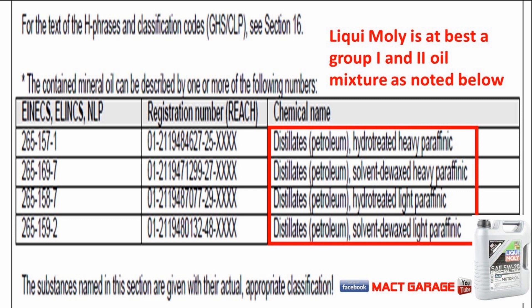This is really getting complicated here, but I'm going to tell you right now — we probably have a Group 1 with a Group 2 mixture, which barely qualifies this oil as a synthetic. It barely qualifies. What they've done is mixed it. They've taken basically a base oil that's been distilled a little bit — it's a heavy mineral oil — and then they've added some hydro-treated mineral oil to bring it up to just barely in the synthetic category. So this oil is not much better, in my opinion, than a conventional oil, and that will play a lot in what we're going to be looking at here.